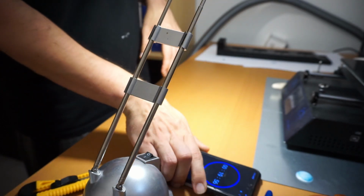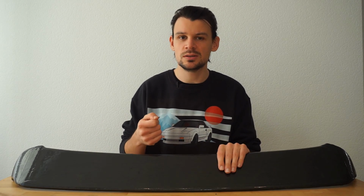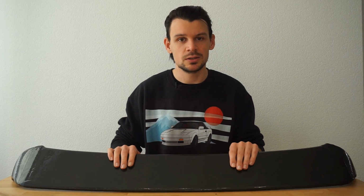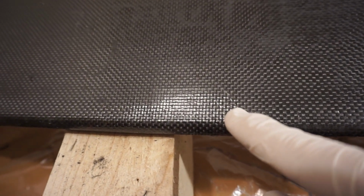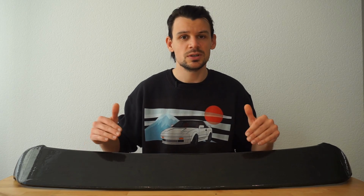When you don't have a timer, like your smartphone, a kitchen clock or something like that, you don't really know if the resin dries or if the resin became like jelly, if the resin needs another 10 minutes so you can prepare or you can work with it. This is very important because when you start moving resin, which is like jelly, with your brush, then you see the structures at the end of your project. So if this happens, then please let it dry like 24 or 48 hours, sand it and put another layer on it.